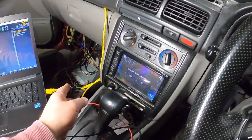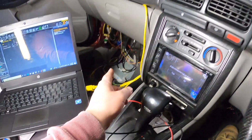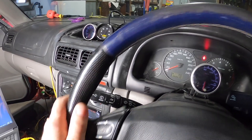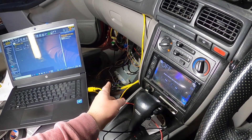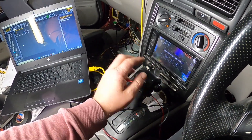I found out why the power light was flashing - the green wire down there for the tach is not connected to the ECU. So I connected it and then I don't get any RPM but the light's gone. If I disconnect it and have the Haltech DPO on there, I get the sweep and I get RPM. Not sure about speed yet because I haven't driven it, but I think the TCU takes the signal from that wire.